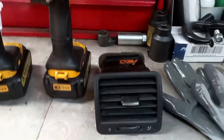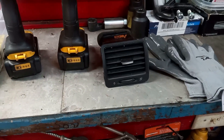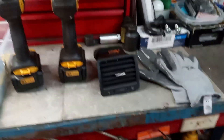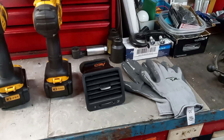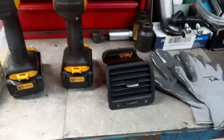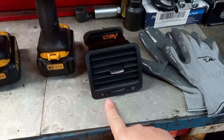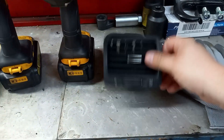I've already popped my vent out — this is what it looks like. We're going to install a boost gauge right here. I recorded this footage already when I was actually doing it but unfortunately the footage got deleted, so I'm going to show you with this spare one I got from the junkyard. Basically, you get a clip puller and pry out gently on all four corners and the whole vent will just come right out.